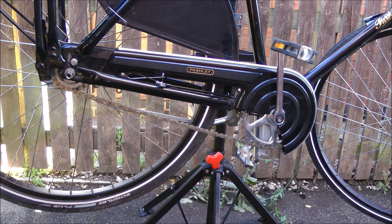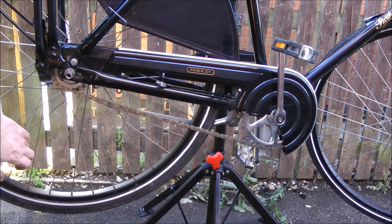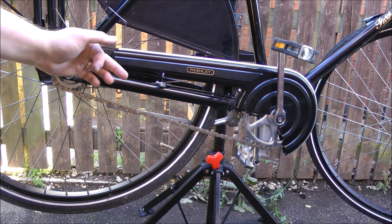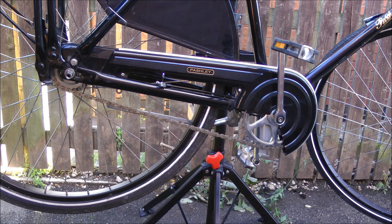I need to reseat this tyre because it's still coming off at an angle — I don't like it. I'm keeping the pressure a little bit low in that one until I sort that out. I'll just slacken the chain off a bit, put some oil on it, put the chain case back on, and then I'll just need to adjust the gears.